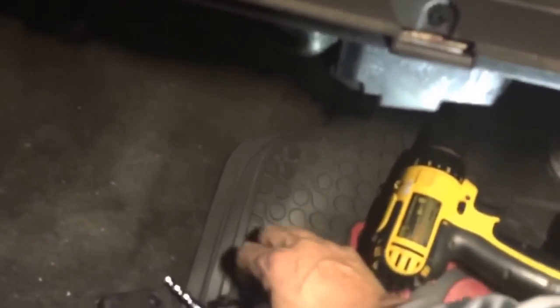Okay, we're back on the airbag. For one, you got to remove this, which was a latch for the glove box. And of course, you had the three big screws out here on the front. You have the small screws on each side. There's two here, two on the other side, and then up underneath, of course, there were two more big screws back here, the same as what was on the front. And if you reach back up in here, you'll see a yellow plug that you have to disconnect, and that's the plug for the airbag.